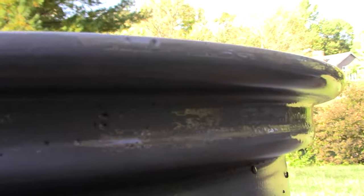I don't remember if I mentioned before, but I am shooting this at like 35 PSI with that Harbor Freight paint gun. So it seems to be laying on nice. I just did the third coat. I don't see any runs. If you have any tiny fish eyes, it's good to let them harden up really well and then lightly shoot over them. And I had a couple on the very rims that nobody would see, like these fish eyes here. But yeah, see on the rim here, there's almost no fish eyes.